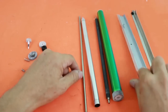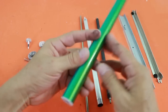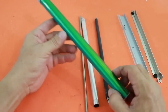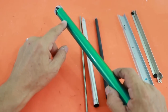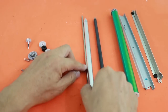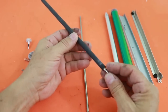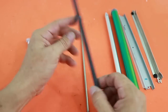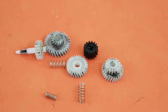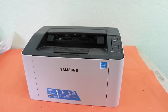Another metal piece. This is the main cylinder of the toner cartridge. It is made of aluminum. It is hollow, and it is covered with a material which is an organic photoconductor — a material that changes its electrical properties when the laser light impinges over the surface. The image is formed here. Another hollow cylinder, also aluminum I think. And this is a piece of some kind of steel covered with rubber, and another steel part. We also have these plastic gears and springs.